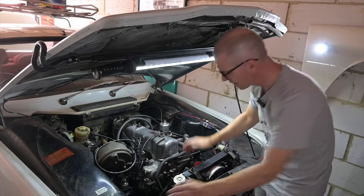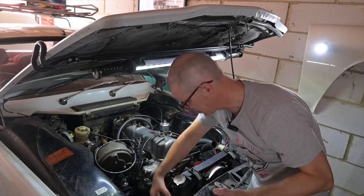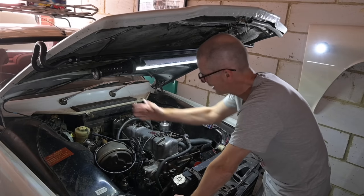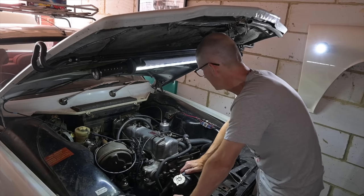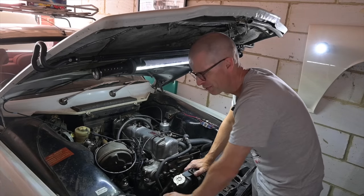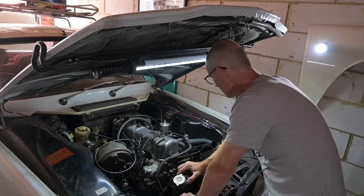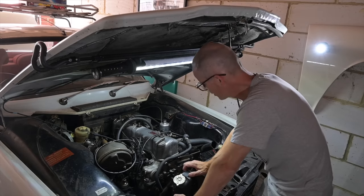The reason it was languishing in here was because initially I was trying to change the engine mount rubbers — not actually these things, but these are all I could buy, which I think are Mark 1 Golf actually. No one made them so that was what was being offered, requiring a slight modification. Being out here with no power tools it didn't work, and then I wound up having to run a massive extension lead from across the street to my friend's house — four or five extension leads long — to get an angle grinder because the bolt holding the engine in place just rounded out and broke. Finally got that fixed and replaced it with hockey pucks, a mad idea which actually seems to work perfectly.